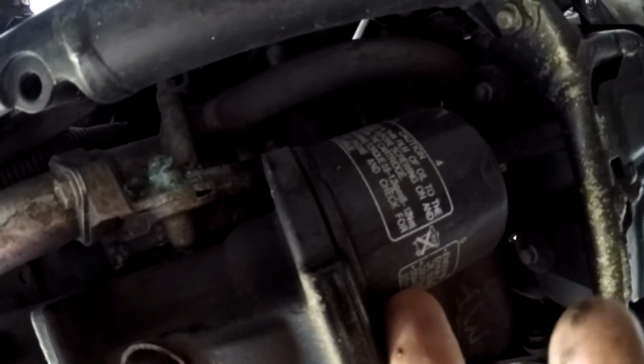It's quite hot here. So first I will unbolt this drain plug and this drain plug. As you can see, they have crush washers, so you may check them for good or bad condition as well. That's the place for your filter. Quite good, quite interesting. So guys, let's start. I put the small one in the front because from the front part we'll have just a few milliliters of the oil, but from this part we'll have the most volume of our oil. Most of the liquid will be going from this side and from this side.